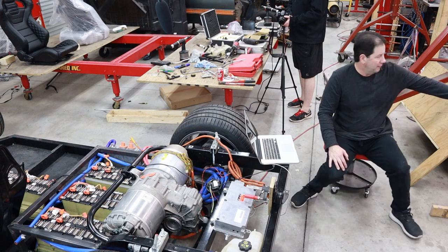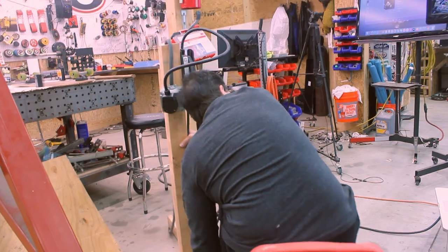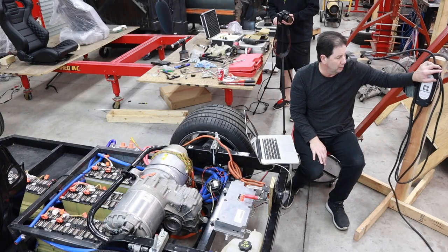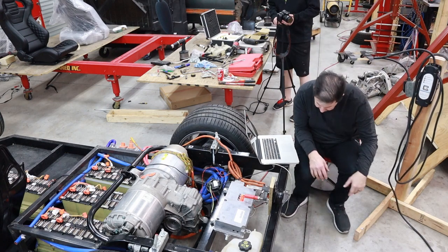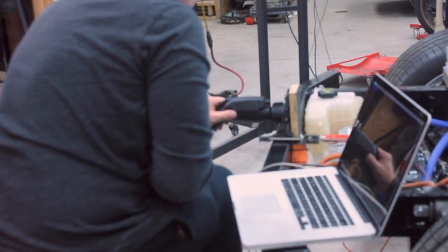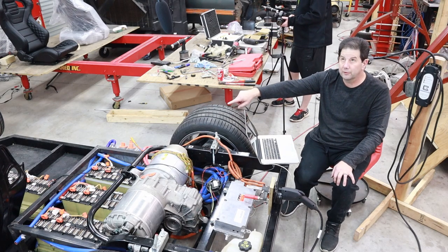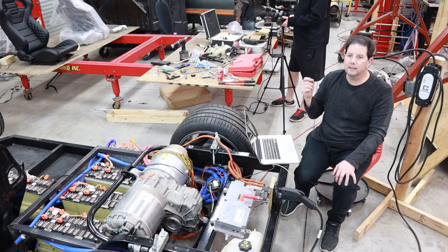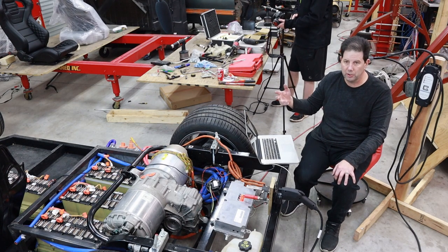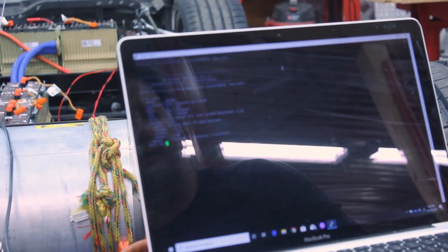So what we've got here is a handy dandy charging station. And this is our 220 coming in from the street. That runs into our plug here. When we plug this in, it talks to the Thunderstruck, which is called an EVCC. That's a system that mimics the original Chevy Volt ECU, which tells the charger to turn on. As you can see on the screen here, it pops up